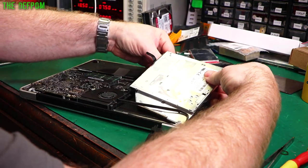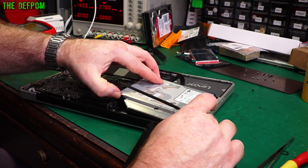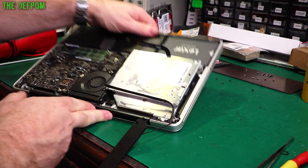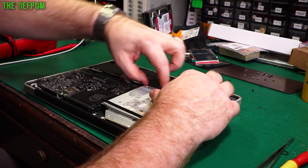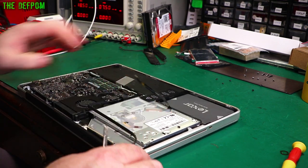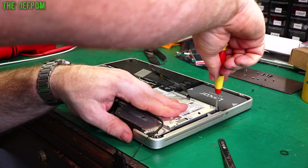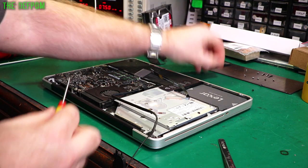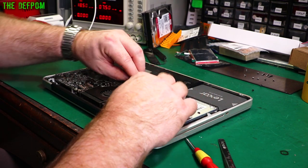Put the CD drive back in again. Let's slot this back in, put the cables out of the way so I don't pinch anything. This one's going to go underneath that drive bracket, just in this corner here — it's got to go underneath so it doesn't get pinched. There we go. That's on top of there. There's a sticker from the battery — always a bit of a pain. That should now sit in there nicely — it does. So I'll put those screws back in. Just visually check the others to make sure they're going to line up.